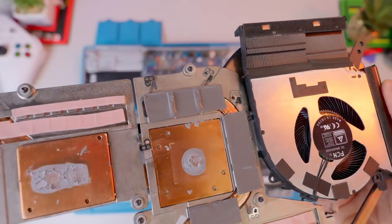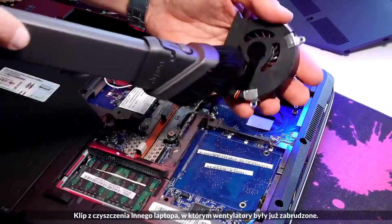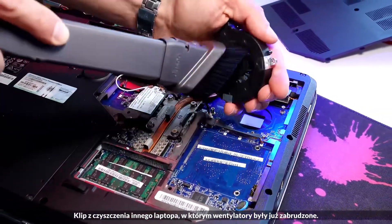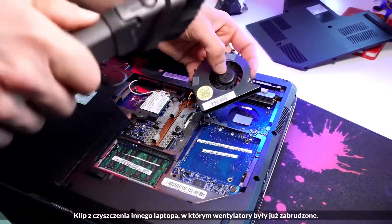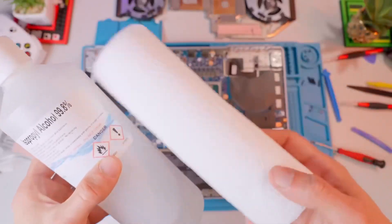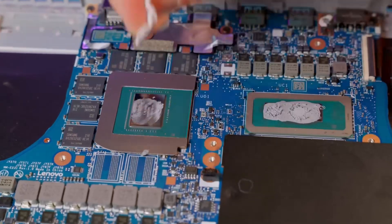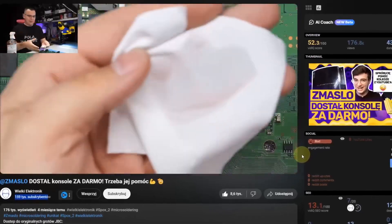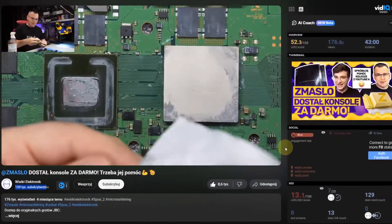While you're at it, if your fans are really dusty, this is the perfect time to clean them. You can use compressed air, a brush — and for plastic parts, it doesn't have to be anti-static. A vacuum cleaner will also work, but be very careful and remember to hold the fan in place with your finger so it doesn't spin up too fast and get damaged. Now it's time to clean the surface of both processors as well as the heat spreader. I'll use isopropyl alcohol and a paper towel. Under no circumstances use tissues or toilet paper — they are too soft and delicate. A product called KT5 apparently works even better at removing old thermal paste; I'll leave a purchase link in the description.